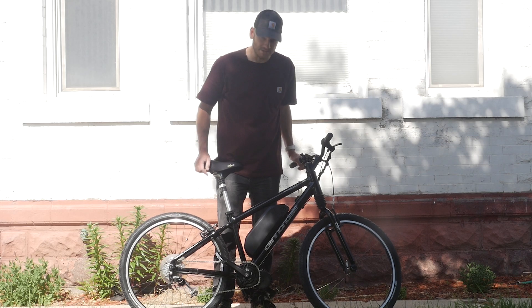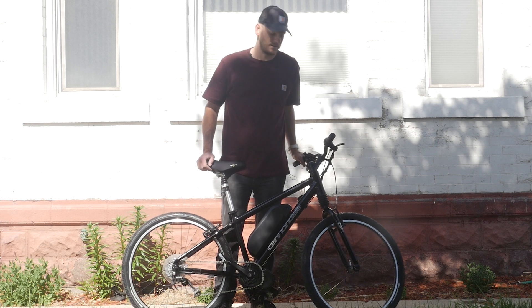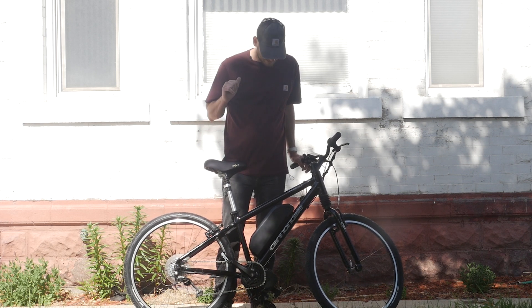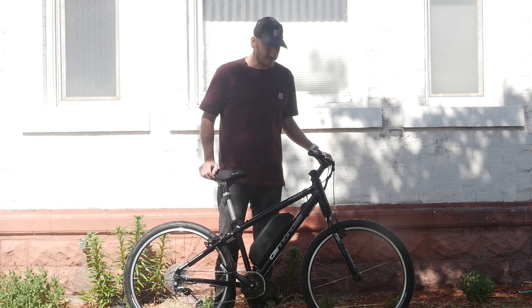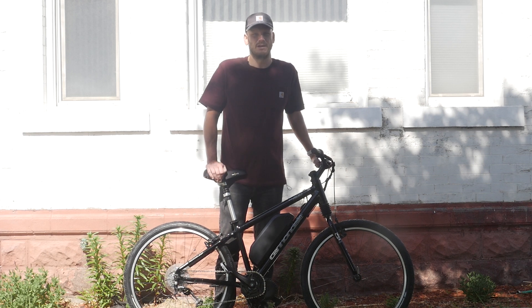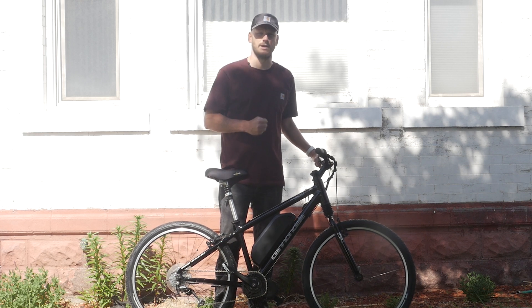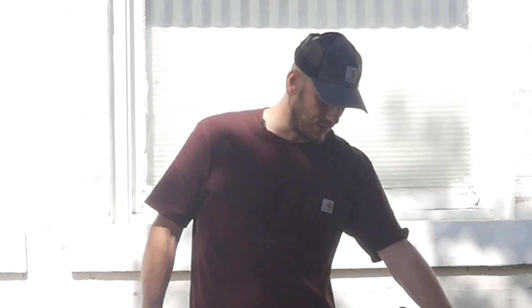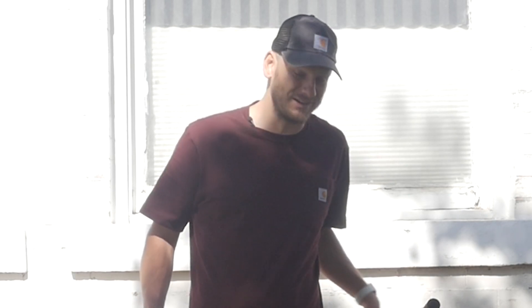It's a Cannondale, so you know you're getting good quality — Cannondale doesn't put out crap. This one does have rim brakes, and people always ask me about that. I always say: check out my other video on rim brakes, but basically if they work good, they're fine. If you live somewhere like Portland or Seattle where it rains all the time, rim brakes probably aren't ideal, but for a fairweather rider they're fine. Put new pads, new brake line, and a new brake cable on for about $15–20 and get them adjusted.